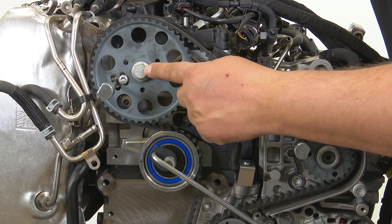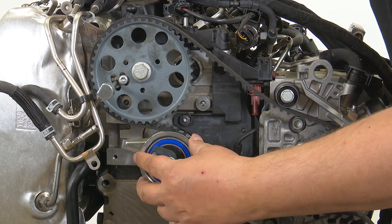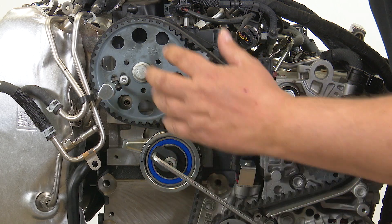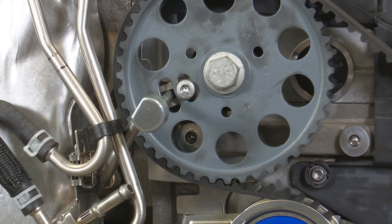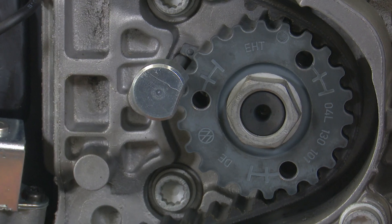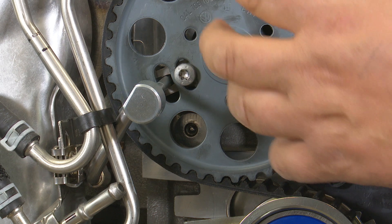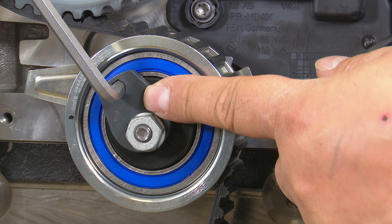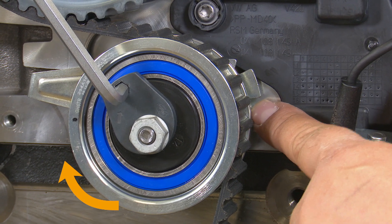Now you're probably wondering why it's so important to loosen the camshaft bolt and the nut on the high pressure pump. It's all to do with the tensioner pulley's tensioning process. When I tension the tensioner pulley, the belt is pulled back over the pulley and we get some movement here. Watch the slotted hole here at the top and see how much movement there is during the tensioning process. If the bolt and nut on these two shafts weren't loose, the sprocket tools could become jammed during tensioning. You now tension the timing belt by turning the tensioner pulley's eccentric cam clockwise until the pulley's pointer aligns with the center of the marker notch.